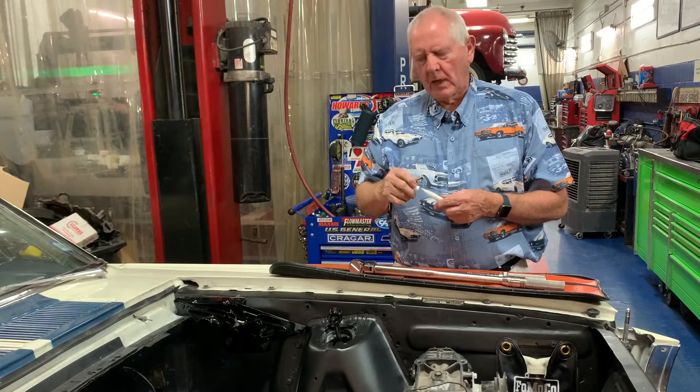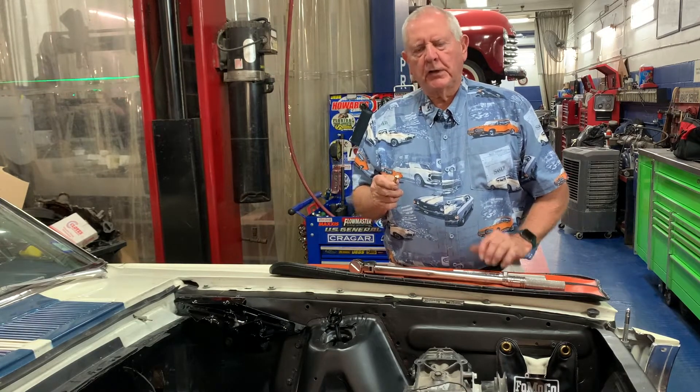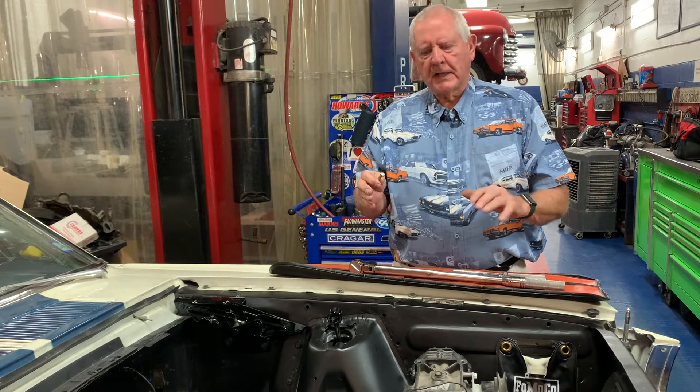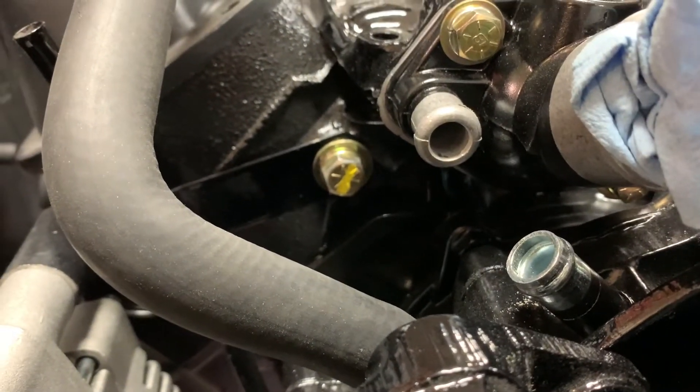Because in many cases, you'll be working around the car, you'll get distracted, you'll come back, and you'll miss some bolts. So you can quickly look at all of them and see, oh, those bolts have all been tightened, so there's no reason for me to go back and catch those. But if I don't see that mark on this bolt, I better go back and check it again.